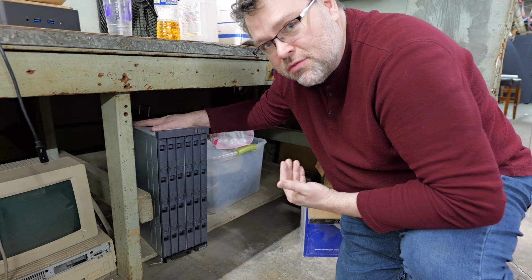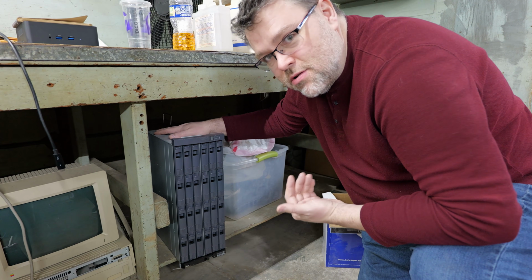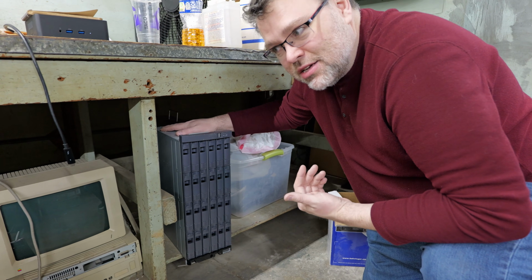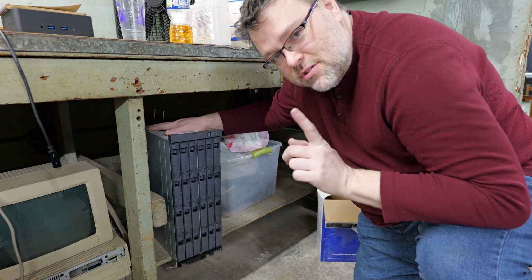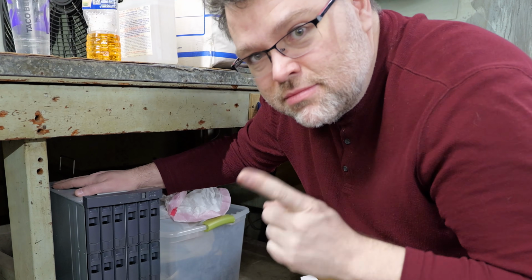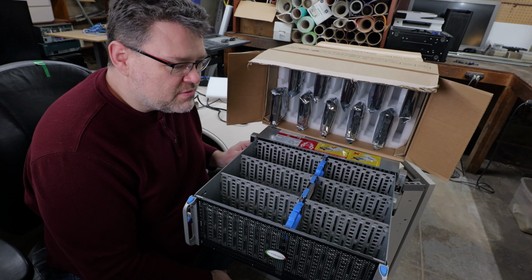It's 24 drives. It's just that those power supplies have been on a long time. The interface is slower. SAS 6 at best. SAS 3 is more typical. They're not bad. It's just they're not a 10-year solution, and they're not something you would run a business off of in 2025. NetApp, it's good stuff. This is the modern 10-year solution in 2025.